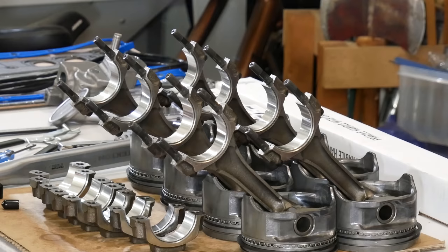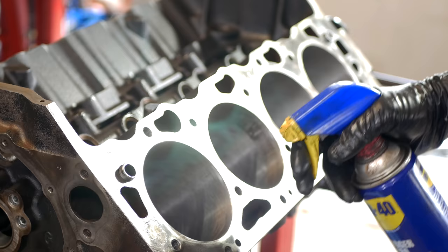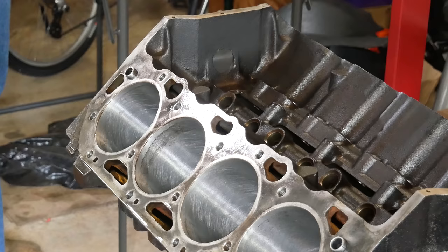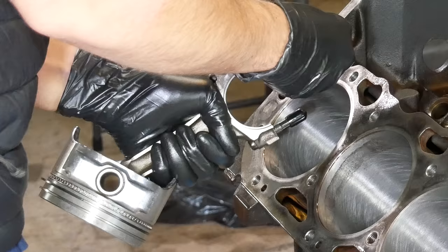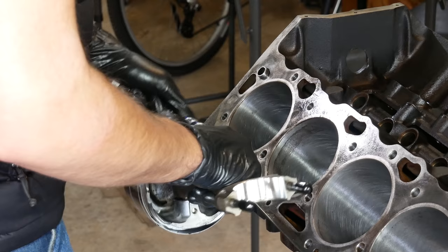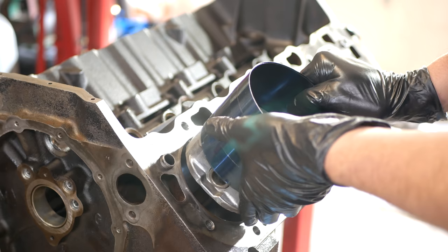Finally all the pistons are ready to go and we can install them into the block. The first thing we'll do is rotate the crankshaft just a little bit to line up the rod journal with the cylinder, which will make it easier to align the connecting rod. Then — and this is a bit controversial — we'll go around and wash down each of the cylinders with WD-40. Some people say it's best to install pistons dry; I think a light oil is enough and makes them easier to install, and realistically it probably doesn't matter all that much. As a precaution we'll place vacuum caps over the rod bolts to keep them from scraping anything up. We'll be using one of these adjustable piston ring compressors, which are kind of fiddly but will get the job done.